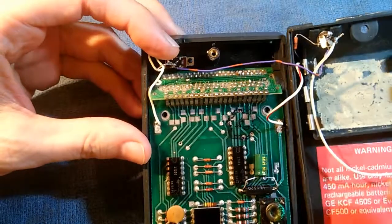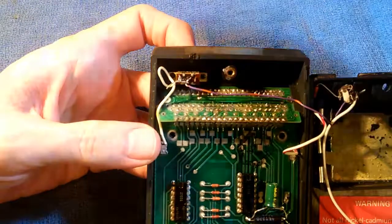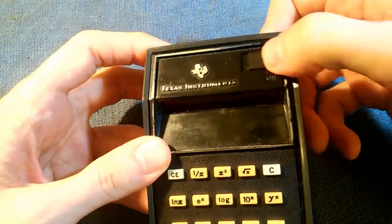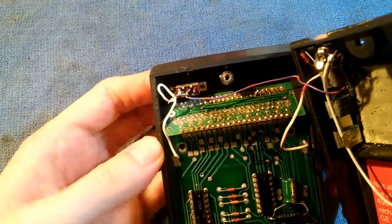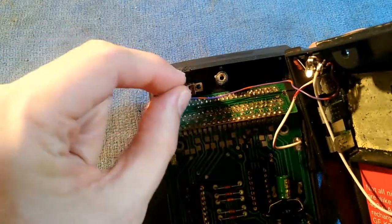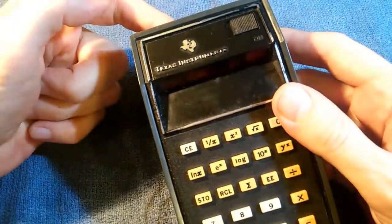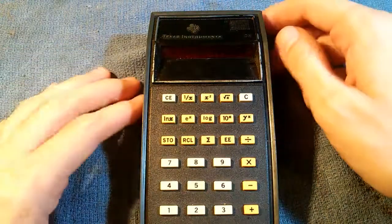I still have the problem of the broken power switch. I soldered in that little piece of metal to basically lock it in the on position — bypassing the switch. I don't know where I would ever find another switch like that, and I'm not sure I could even get it out. The switch itself is melted into place on two pegs — they slide it over the pegs and melt them, holding it in place. I don't know how I would get this out even if I could find another one. At least this way it's on; whenever connected to the AC it just turns on automatically.